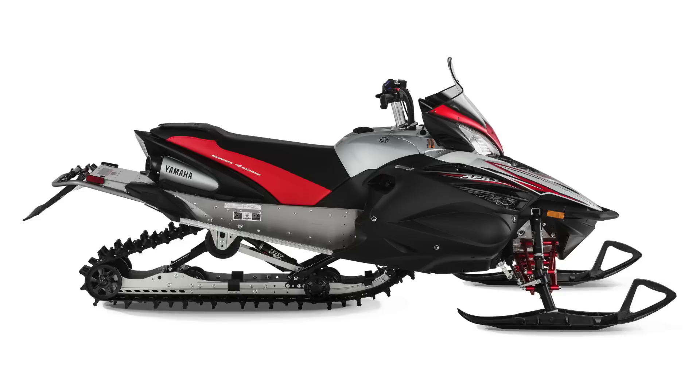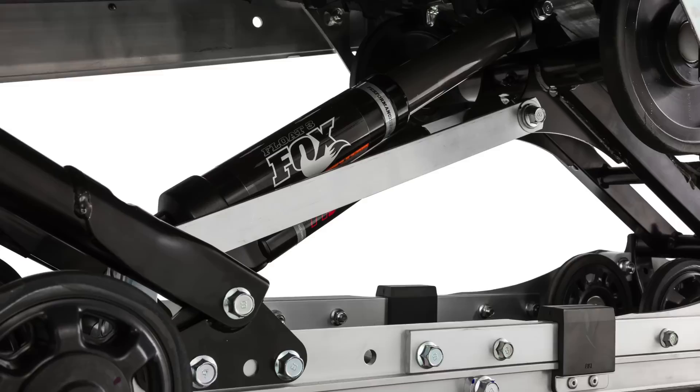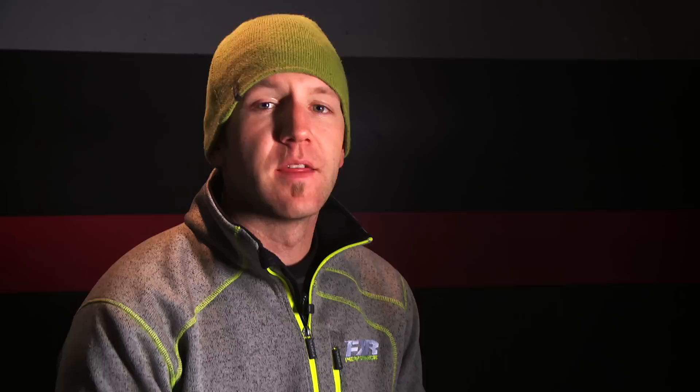While we've had the opportunity to see many of the new 2016 sleds, we haven't had the chance to get our hands on the new Yamahas, but that doesn't mean we don't have all the info. The Apex will see weight reduction of up to 10 pounds through the use of a new rear skid frame called the Single Shot, using a new Fox Float 3 XV air shock. This same suspension can be found on the 2016 Vector with similar weight savings. Another big feature on the Vector is Yamaha Chip Controlled Throttle, or YCCT, which allows users to select three unique throttle maps and will appeal to novice or rental riders.